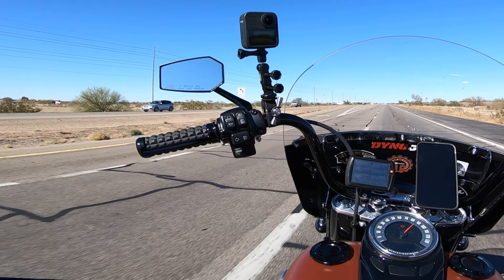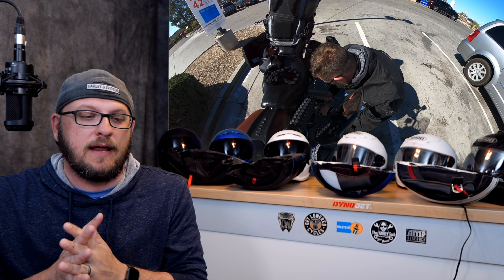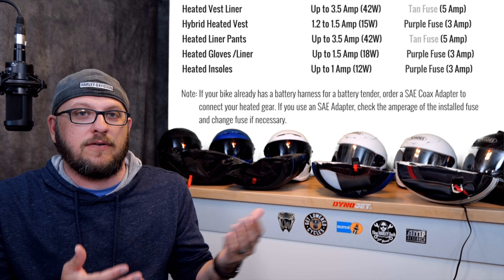That's when I realized this stuff is awesome. It dropped down to below 50 degrees, and when you are doing 80, 85 miles an hour, it gets cold and it gets cold quick. When I opened up the bike, I saw that Harley Davidson has a seven and a half amp fuse. I know people are going to say you never upsize the fuse because that's what causes fires, and you would be correct. However, if you look at the Hotwired manual, it will tell you which fuses you should substitute into that SAE connector. Seven and a half amps is really, really low — it's mainly because from the factory they're only putting in what is absolutely necessary for that connector to do what it's there for, which is to put a charge to the bike. I would recommend going with the smallest fuse that you possibly can. It's always better to keep it smaller so you don't create electrical fire issues.